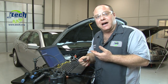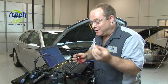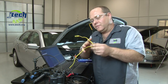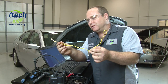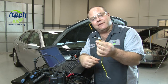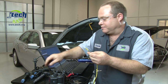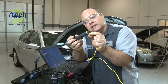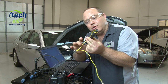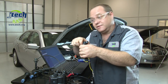A vehicle such as this behind me — this is a Ford Fusion — and it's so well insulated, this won't pick up the signal. We have to do something different. To accomplish the goal on this car, we built something like this. It's simply a piece of wire with an alligator clip on one end. We made a lasso on the other end, and in the middle we have a nut and a bolt. We're going to take this loop and lasso the bottom part of the coil, and run the wire straight up next to the coil so we can reinstall this into the vehicle, because the vehicle does need to be running for this to work.